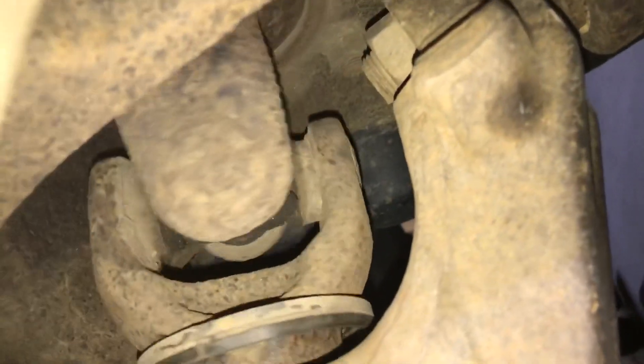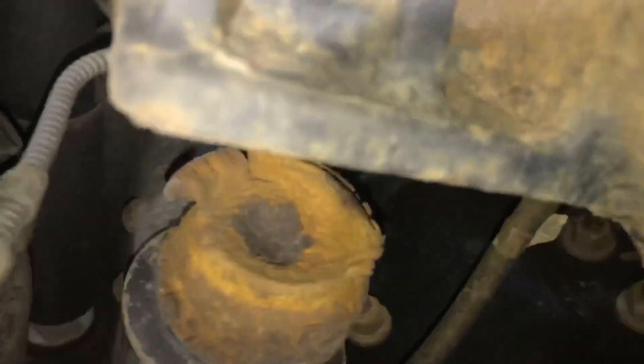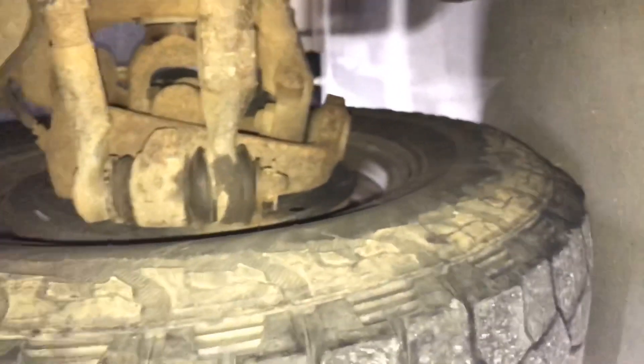Alright, turn it to the left — it's working good. Turn it the other way. I'll get a video showing a bad one. Content is probably about to change a little — Tanner's going to start editing videos. Bump stops — those aren't bad, they just pop on. We lift it by the center of the axle to check steering so we can turn it, but I did have them check this ball joint. It's easier and more definitive if you have one wheel on the ground then jack it up by one side so that wheel is stationary.